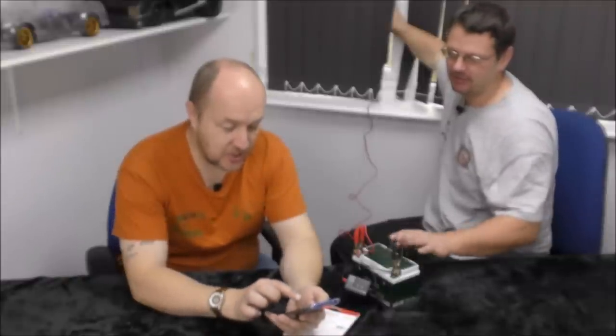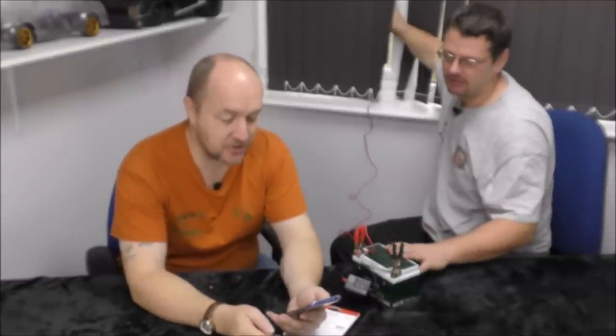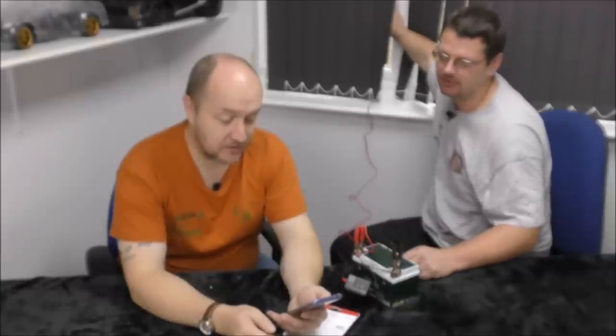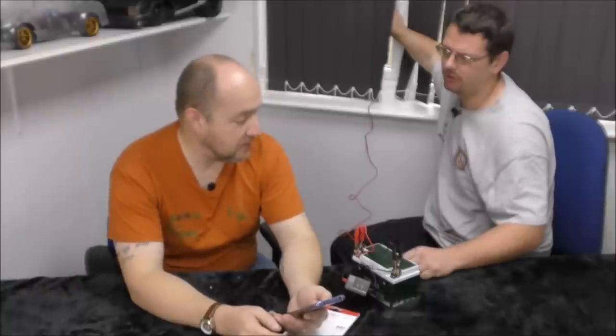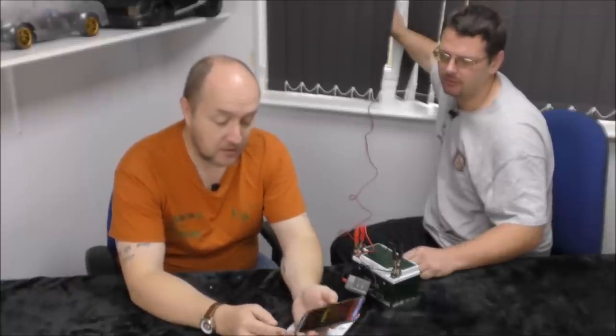So, charging. Just do a charging test. Oh, no, we can't. Start engine, turn off any devices which use power. And then turn on headlights. I think that's what you normally charge off or whatever. Okay. Apply load. So there you go.